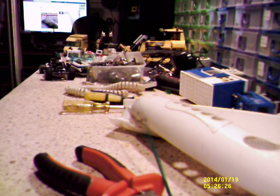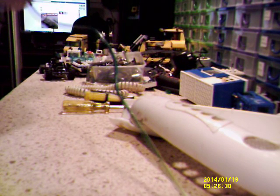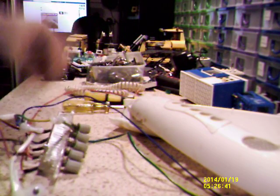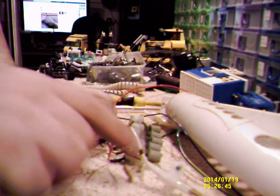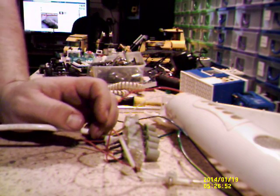Mains power goes into the bottom switch here. Then those three are your three speeds that go up to the motor. I wonder if it's done by different windings on the motor, because I can't see any resistors or anything on that that would be used to change the speed of the motor. So it must be done somehow up here. It'll be an interesting look, wouldn't it?